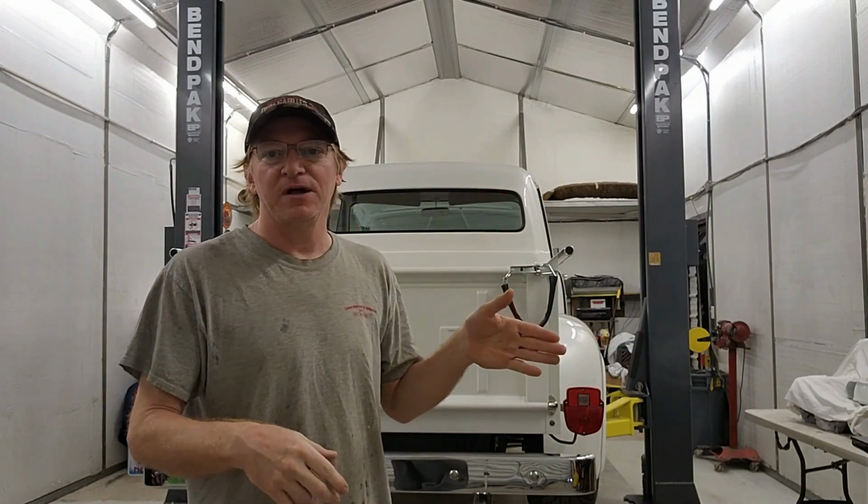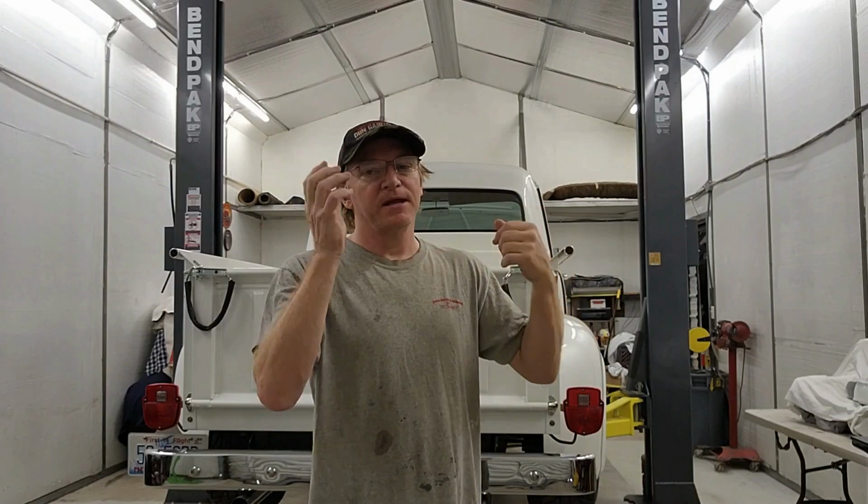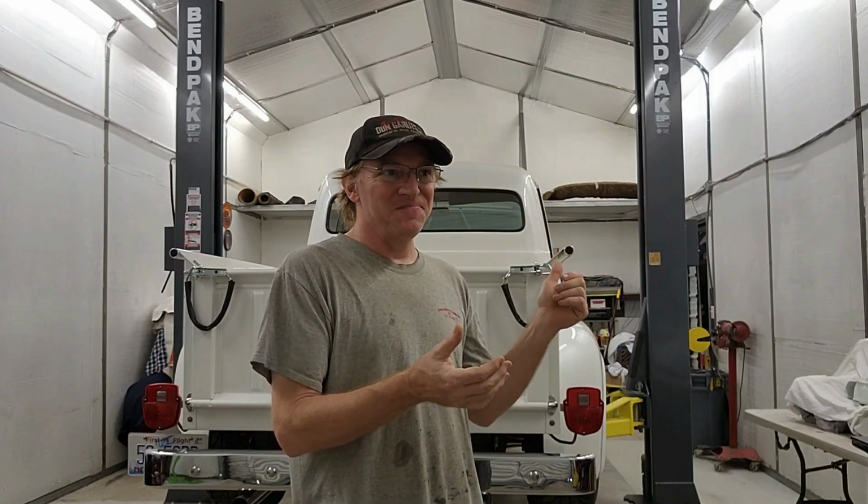We don't know if it's a forward clutch or the clutch in the back, but I have a problem where I'm not building enough pressure until I rev up the vehicle, and then when I rev it up, I get enough pressure to overcome it to apply the clutch. And this weekend, like yesterday, I had the owner with me, and we took the pan down and then untorqued and did breakaway torque on all the valve body bolts.